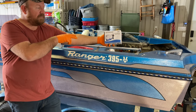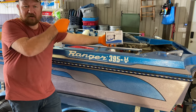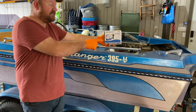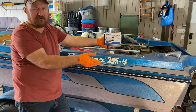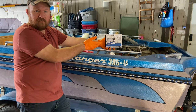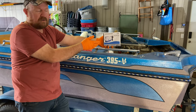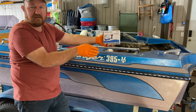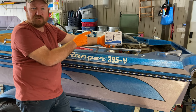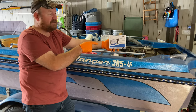It has two power wires that run the pump, so you can run it manually with a switch. It also has a float inside, so if your boat starts taking on some water, that float will come up and that wire is run to a straight hot wire — it'll just automatically start pumping the water out of your boat. That's a great feature I really enjoyed on my other boat, so I'm going to get started installing it on this boat.